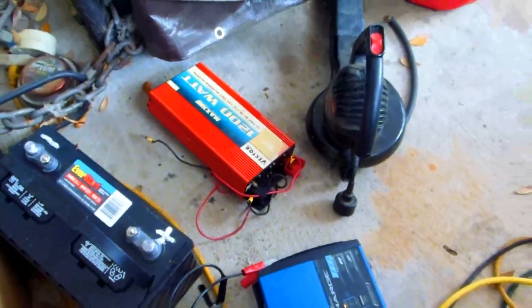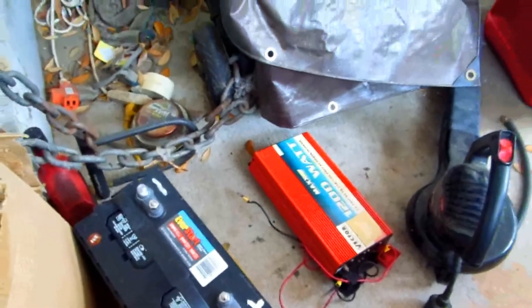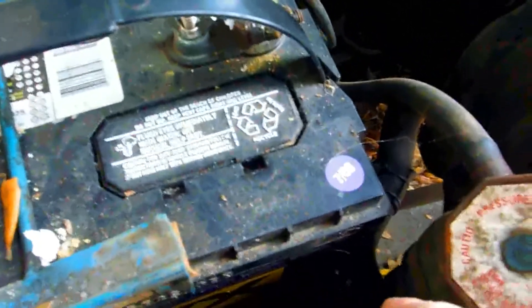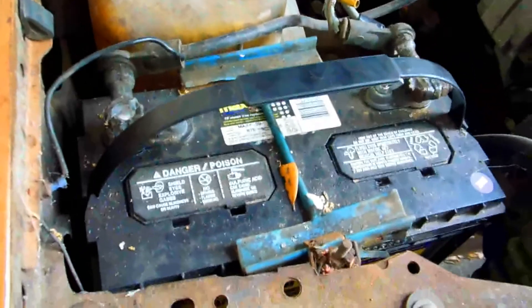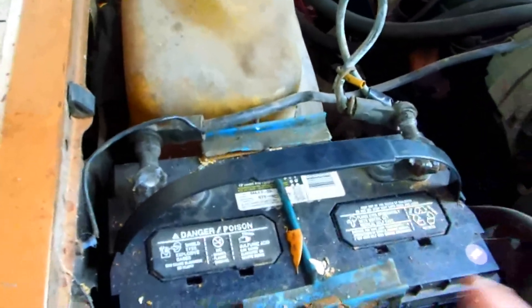I had a total fail on trying to restore another battery — it was a group 27 Walmart-type battery for starting a car. I replaced it with a group 29, which I put in the El Camino. It just barely fits, and I put some rubber on the side in case the battery casing touches the metal. Even though it's a deep cycle battery, since it's a group 29 it's huge and starts up this 350 no problem. You're not supposed to use a deep cycle battery in automotive applications, but if it's so oversized for the application, it works fine.